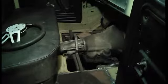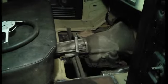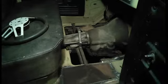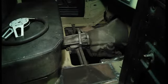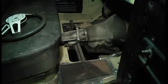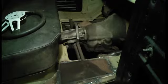I made a one-by-one by one-eighth-inch thick structural steel tube that goes underneath the floor and over top of the transmission. It bolts into the rocker panel — I put a piece of eighth-inch one-by-one angle iron up into the rocker panel and plug welded it on both sides. I also have a 5/16 carriage bolt holding it on, and that's what's holding up the running boards. I'll show you what it looks like underneath.